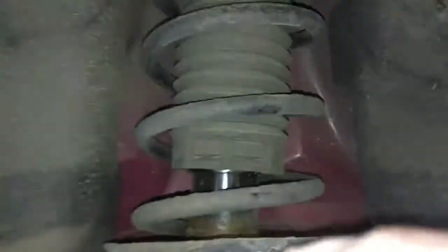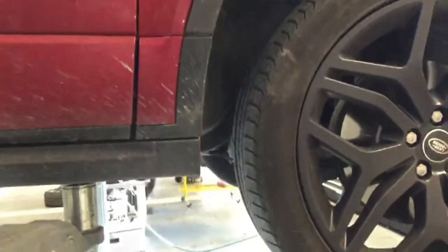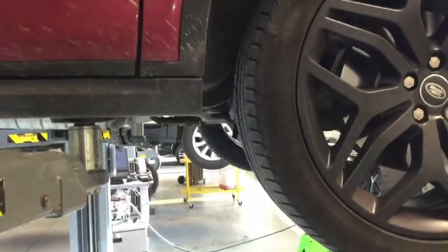While the vehicle's on the ramp we check all the suspension on each side. All the springs are intact on this near side rear, and also the near side front — spring looks perfectly fine, no fractured coil wear. Driver's side again fine. The dust covers are also intact. The off-side rear all perfectly fine, correctly located. There's a little bit of body damage here. I'll raise the vehicle up in the air and show you some of the concerns, and I'll also show you your tyres as well.